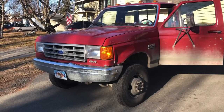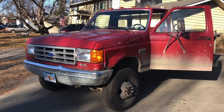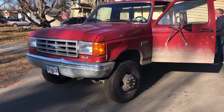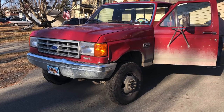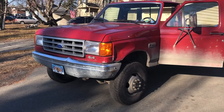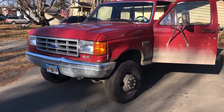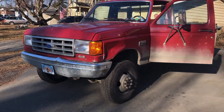All right ladies and gents, this thing is getting delivered. We're going to change the fuel water separator one more time after it starts getting driven more, and we're going to continue running diesel clean through it. The issue was it stalling coming to a stop - pushing in the clutch or when revving it up it would stall. It's almost like a little metering valve got gummed up and nastied up from sitting. So here we are - now we'll do the fuel water separator change next.